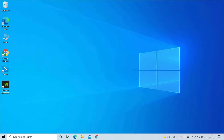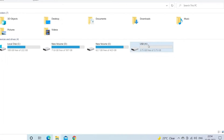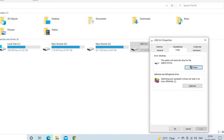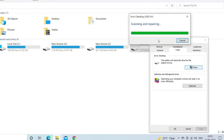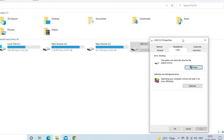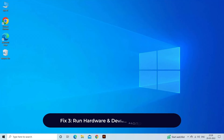Fix two: run Disk Check to fix hardware-related issues. Always perform a disk check to examine disk errors. Right-click on the USB flash drive you wish to check and select Properties. Next, click on the Tools tab, and under the Error Checking section, click the Check button — this will check the USB drive for file system errors. Follow the on-screen options to complete the disk error check, then restart the system to resolve any errors found.